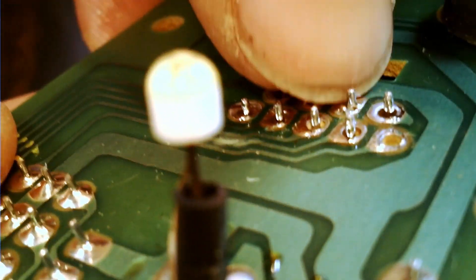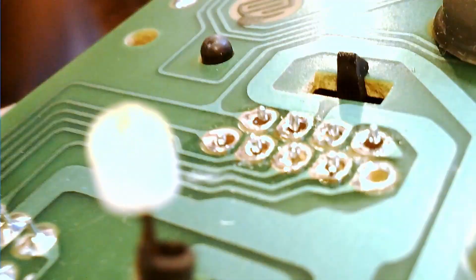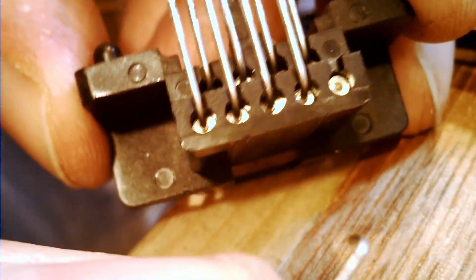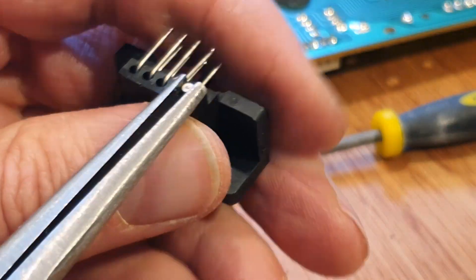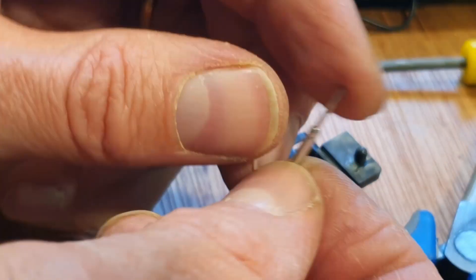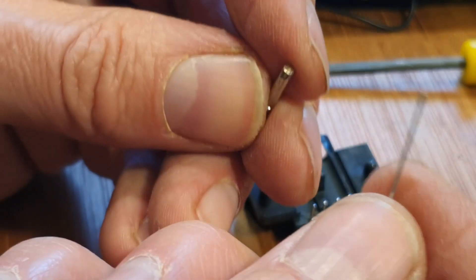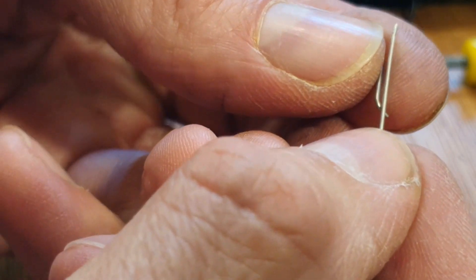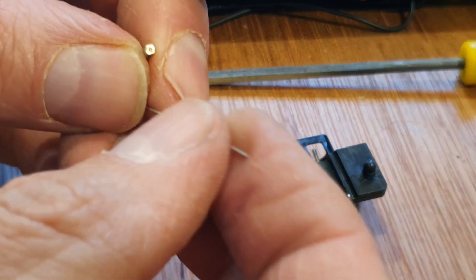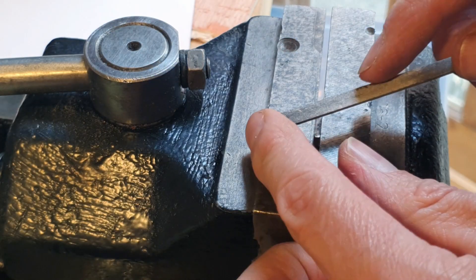A little lever with a grimy fingernail and the remaining solder breaks away with minimal force. You can see where the broken pin has come from, so I'll need to work out a way of repairing that. Constant yanking against the port has made this pin shear right off. I decided to use an axial capacitor leg from a Spectrum service to replace the broken port leg. It's slightly thinner than the original — around 0.5mm compared to 0.6mm — but that shouldn't make too much difference. It'll still be stronger than the remaining ones.